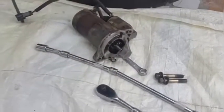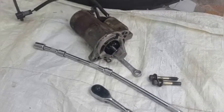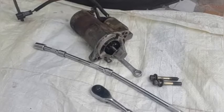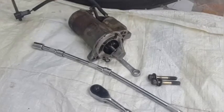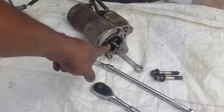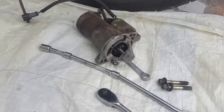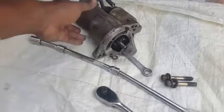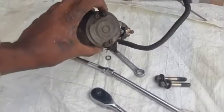This is the second time we are removing the starter for a rebuild. The reason we are removing it is because oil from the crankshaft rear main seal will leak into the starter and enter itself into the motor. We are now going to go into the starter to make the necessary repair to its brushes on the back of the motor.